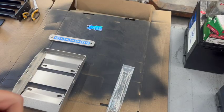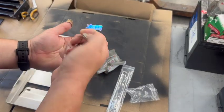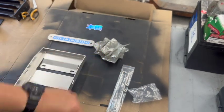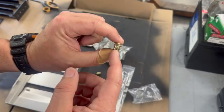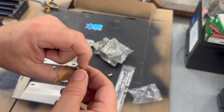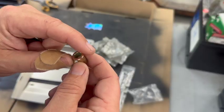If you choose the self-tapping screws, we can include them in the kit. What we prefer is in this bag here. We've got two nylocks — quarter-20 nylock stainless nuts for the J-hooks. We also have what are called rib nuts. If you're unfamiliar with how rib nuts work: you use a rib nut tool or a nut-and-bolt method. This is an uncompressed rib nut, and this one has been compressed. You take the rib nut, drill the appropriate size hole — for this M6 rib nut, probably around a 23/64 drill bit, though don't quote me on that — then stick the rib nut in.